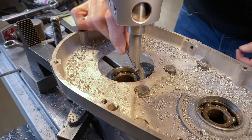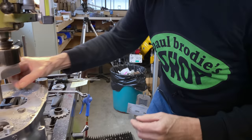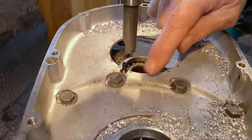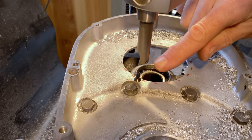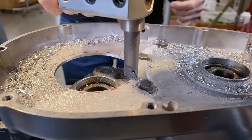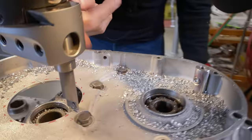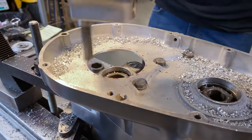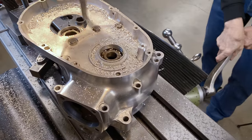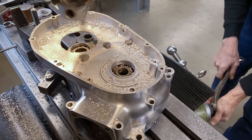So now I've got to face this here. I'm going to show you the Allen screw we're going to use — they're very small 4mm Allen screws. There's not a lot of space there, but that'll go like that. I'm going to have six of them all around there. I need to face this now. I'm going to put it on a really slow speed. I'm going to bring the boring bar down and I'm not going to use the feed in the quill — I'm going to raise up the table because that's more secure. We'll get a little bit more speed going, about 100 to 160 RPM. I'm going to raise up the table slowly.